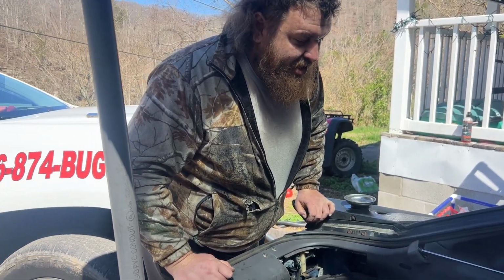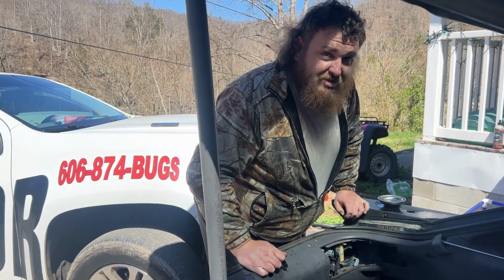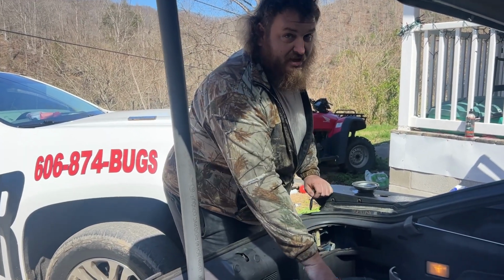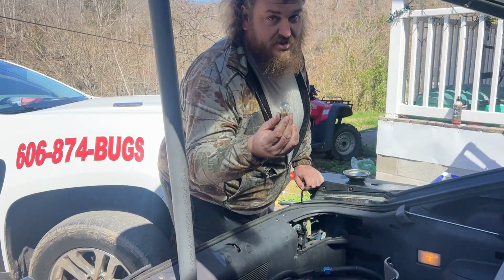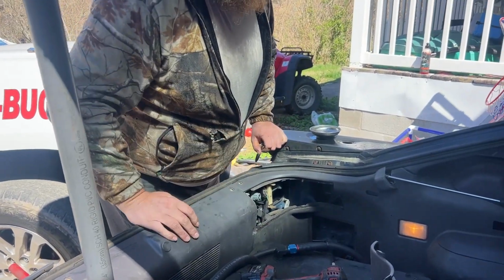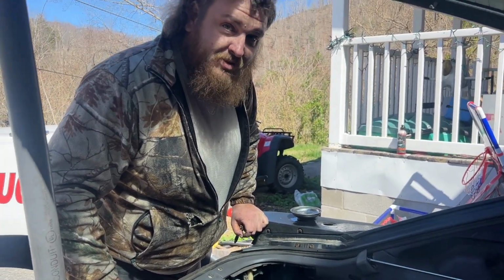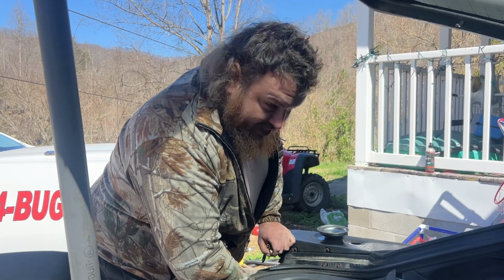I'm not looking for the obvious things. Which would be the bulbs? That's where I would start. No, I did change the bulbs. That was the first thing I did, because I just assumed the bulbs sucked. Changed the bulbs, still didn't work. Would you like to know what the problem was? Ground? No. Even dumber. The harness wasn't plugged in. I never plugged it in right there.